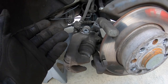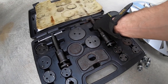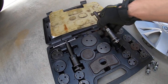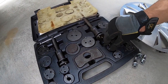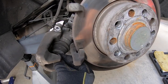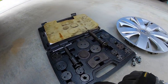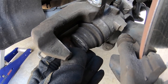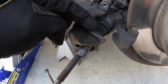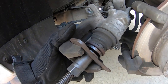Let me get the tool — I'll link it in the description too. Here's what a brake caliper tool kit looks like. It consists of one of these — see how it says 'right hand' — so it's going to turn the piston in. You're going to have to find the adapter that fits, so you'll see a series of different adapters. Grab one and put it up to your piston to match it up. That one's a little too small, so I'll go through and find which size fits. Here's the adapter that fits in our case — you can see it locks into place. Now let's put it on the tool.